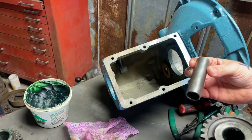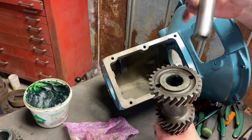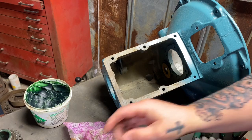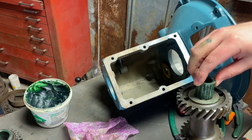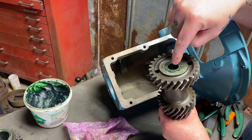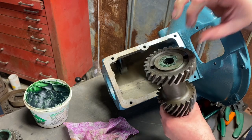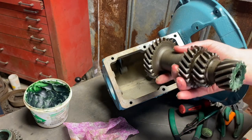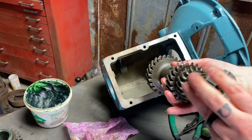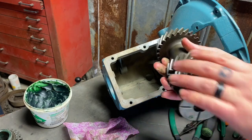The splitter, I put a bunch of grease inside here. I didn't grease this, but I greased the crap out of the inside. So assembly lube, grease, whatever. Then my other short bearing here. Now, different years have different sizes of that offset bar and different sizes of the bearing. So just be mindful of that. I ran into that once or twice. And hopefully this sticks on as good as the first time I did it. That was nice. Stuck in place.